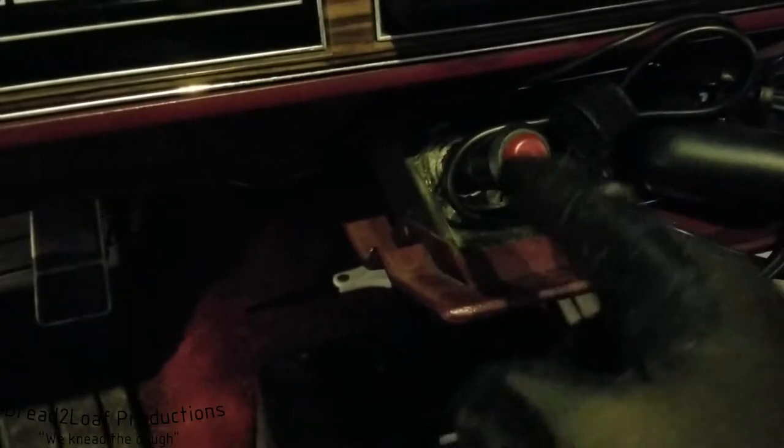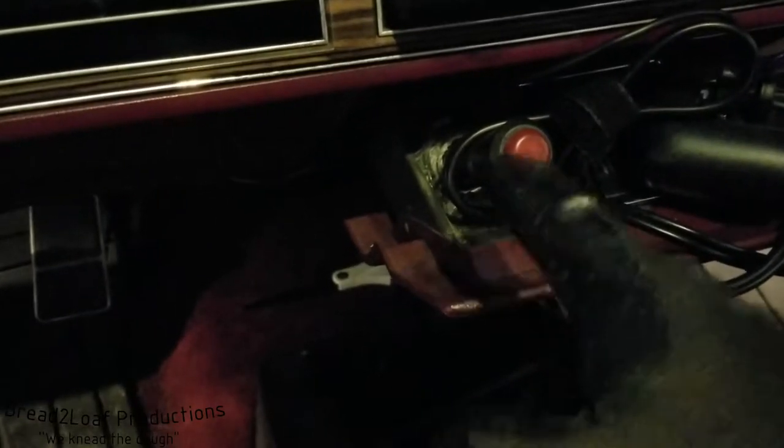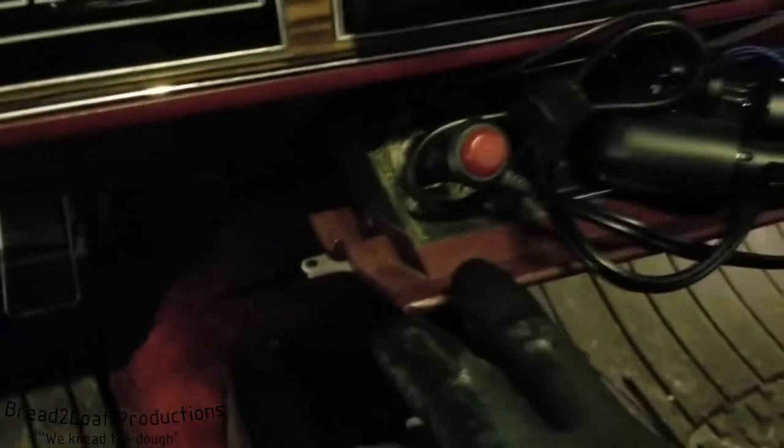And I'll be installing this upside down like this so I can flip it on and off and it will be semi-discrete. And since I want this dash cam to be on and off even when the car is off, I'm going to be hardwiring it into an always hot source, which in my case will be this 12 volt outlet. The wire coming up to it provides positive 12 volt power.